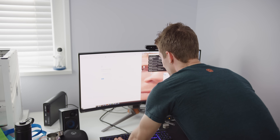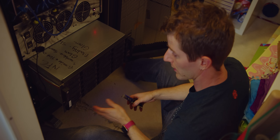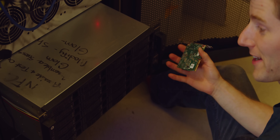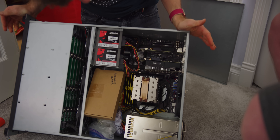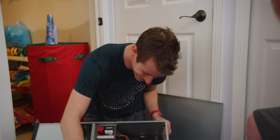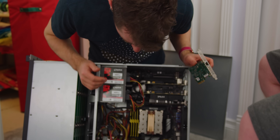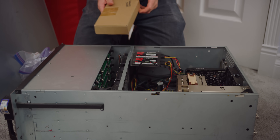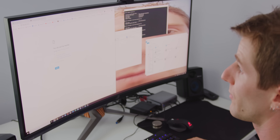I need to shut off my NAS so we can put a 10 gig card in it. Long-time viewers will probably recognize this as old Wannick — it's a Z390 Pro ASUS workstation board with a 9900K and I'm pretty sure 32 gigs of RAM. I'm actually not running any VMs, well, one VM. I don't have any screws for the card slot — we weren't using it anyway, and it completely blocks all the airflow. So we've got two 10 gig clients now.